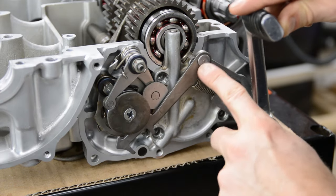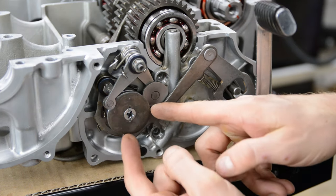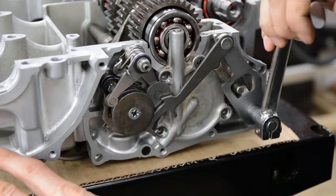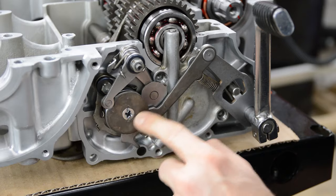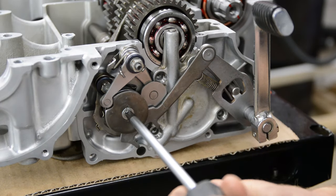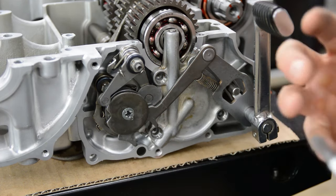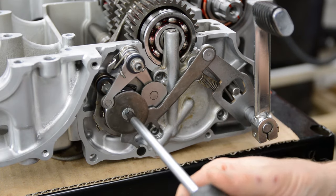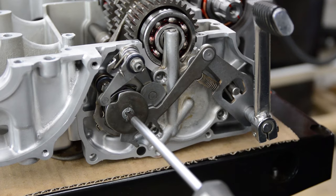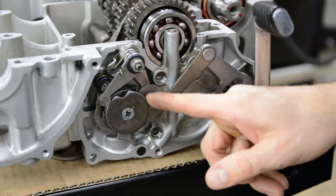As you push this back and forth, there are pins in here. There are little teeth on here that grab the pin and rotate this shift drum. This wheel here sits in between two pins. I can take a screwdriver and rotate this — see how it rotates up and down? Right there it's falling into two pins, resting and locking into a position which corresponds to a gear.